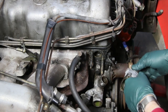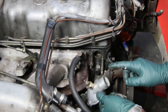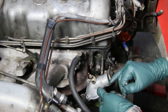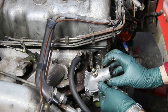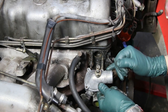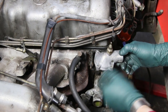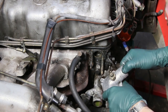You might be wondering how to protect against this. When I put it back on, I take silicone grease — just a light film, you don't want to glob it on and get it into the cooling system — and apply it around here before putting the hose on and clamping it. That silicone grease will retard, though not necessarily stop, any future corrosion on the pits you can see on the upper part of the housing. So we'll get that all cleaned up, get it back together, and my thermostat issue will be solved.